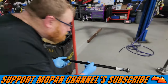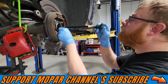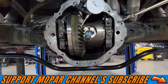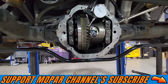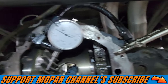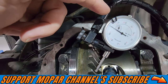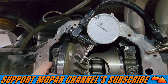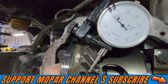Basically what you're doing with this tool is you put a ratchet on one end of it, it goes down the tube, it goes into those collars and you are either tightening or loosening. Give or take which way you got to go to get the proper backlash that you need — you may tighten the passenger side a little more than the driver side or vice versa. This is a cheap Harbor Freight dial indicator gauge, clamped on the ring gear. We're shooting usually like six to eight thousandths, and we're about a good seven.